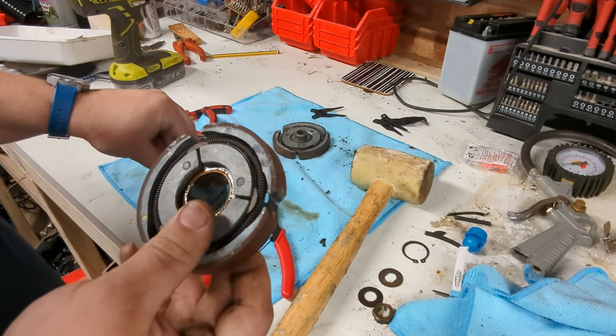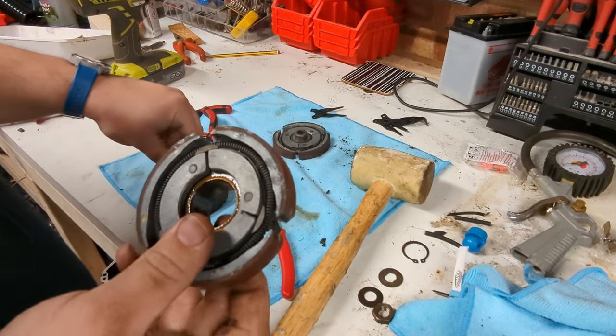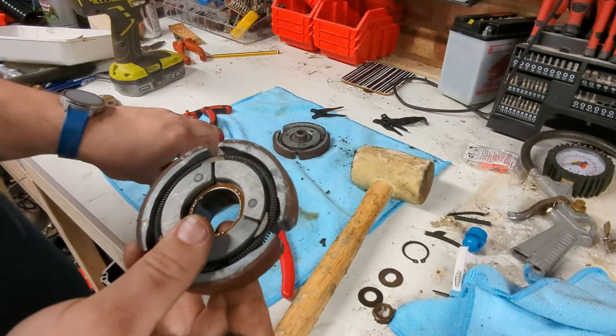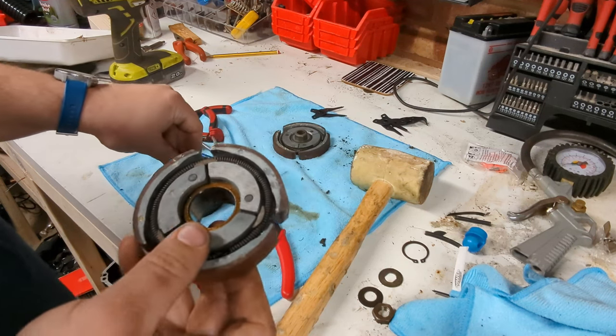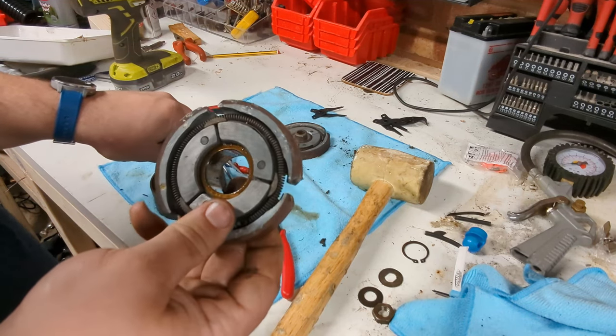Due to the tune of the engine and the power band being moved about a bit by my antics with exhausts, it got to the point where there was too much speed and not enough torque to shift properly. And probably I could be a little more aggressive with the timing on the bike, but I'm still pansying about that since I blew it up in a video you've seen before.